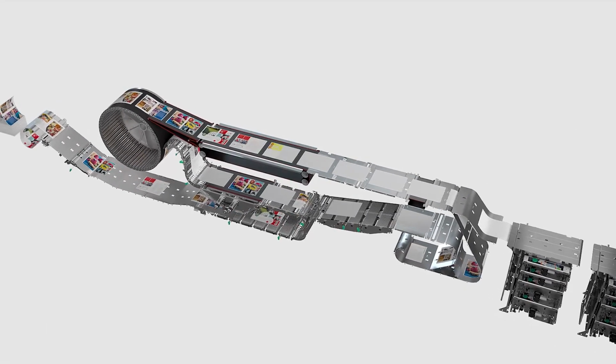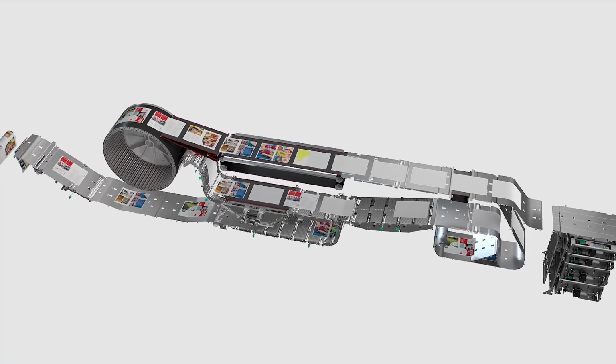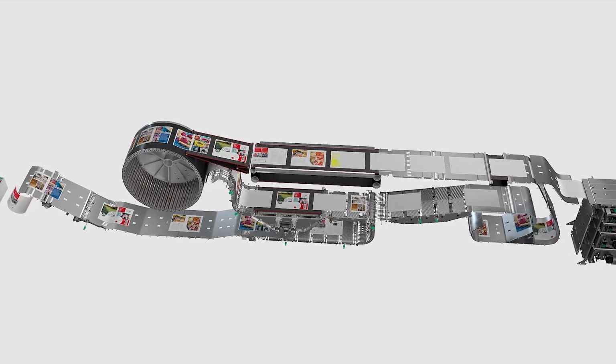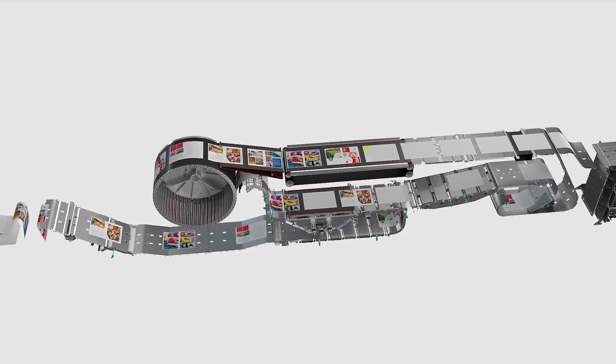The state machine constantly monitors the movement of the sheet through the process by cross-checking the expected time of arrival with the actual arrival, 120 times through the entire paper path. When a deviation is noticed, a follow-up action is initiated. Slow down, speed up, or start an error recovery scenario.